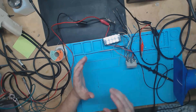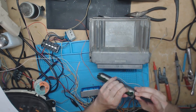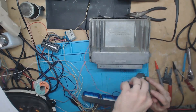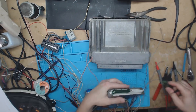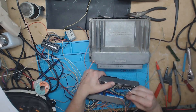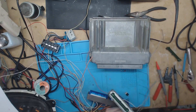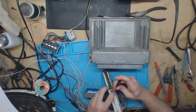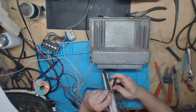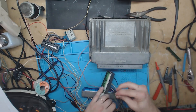First I'm going to show you how to de-pin these and take the pins out. You've got two little tabs here on the side — just push in, then push the other one in, pull up at the same time. I got it hooked up to some stuff so I'm fighting all those connections. Alright, take the little cover off. I need to take off pin 61 here on the green connector — it's a low reference for the ignition coils so it's just something I don't need. Push up on this little tab, then push gently and pull out with the other hand and it'll come right out.